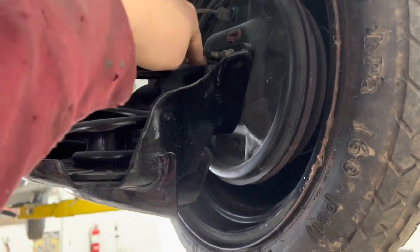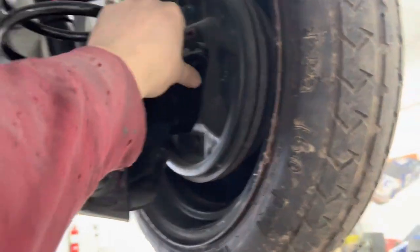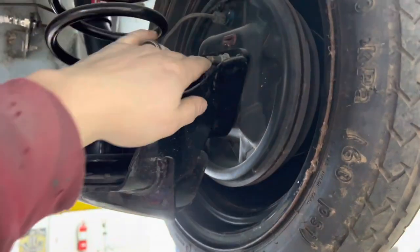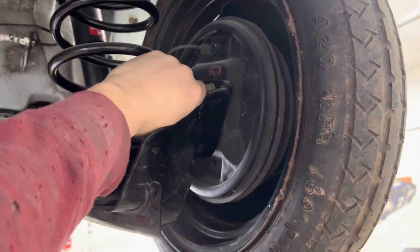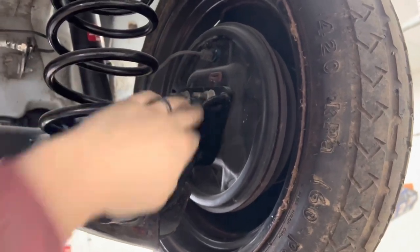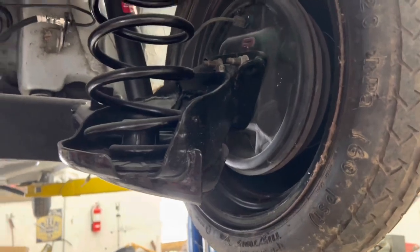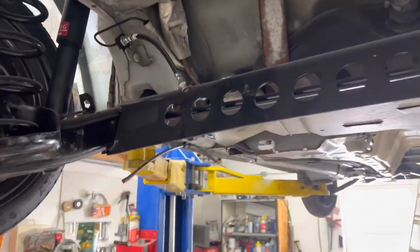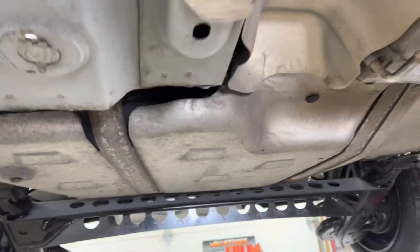It talks about how we put this piece across the top. We wrapped this bar around it, this flat stock around the outside of it, because this Chinese steel is just weak, or Korean steel, or wherever the hell it came from. GM used it, and it's fine for street use, but when you start beating on a racetrack, it can't handle it. So, yeah, rear end's all reinforced and cleaned up and painted, and brake lines and stuff are all replaced on it. We haven't put the skid plate on the gas tank yet, and there's no exhaust in it, obviously, because there's no drivetrain in it.